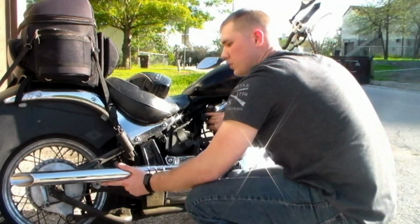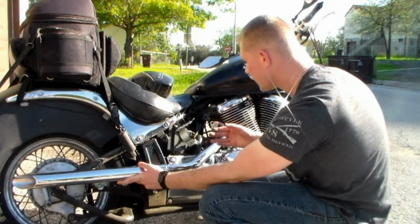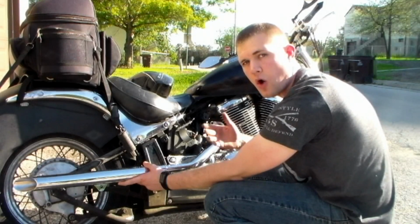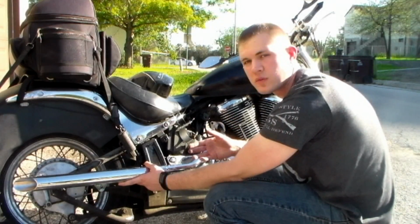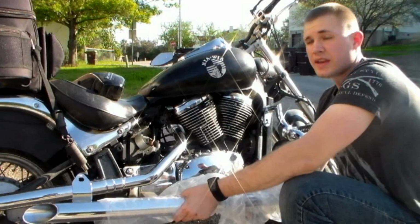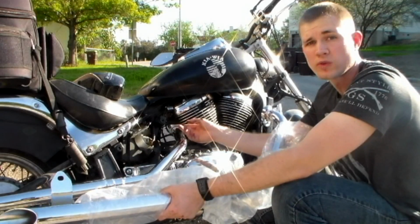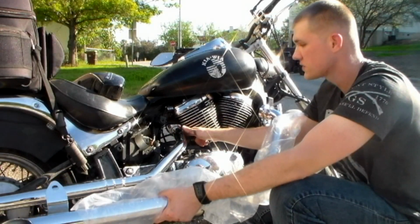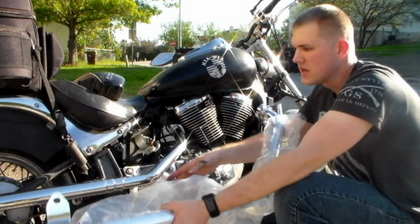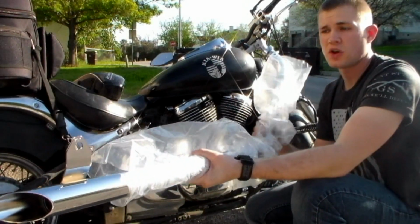So we're going to put this into place by installing the other bolts, and the key thing here is that when we're doing this installation, we do not tighten anything down all the way until all the components are in place, to make sure the proper fitment is there. Now that we've tacked our pieces in place, we just hand tightened the bolts. We have the 2 up here on top, and we use that Allen wrench just to get into place, and then hand tighten them, and also the one back here in the rear. So now that that's in place, we're going to install the other one.